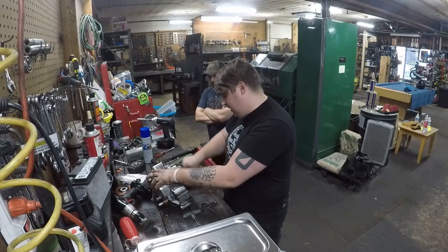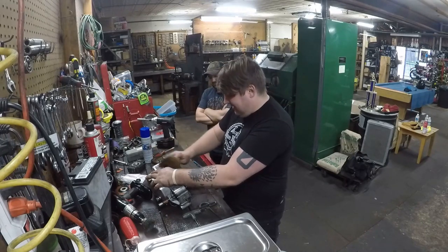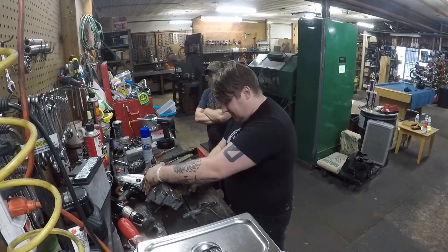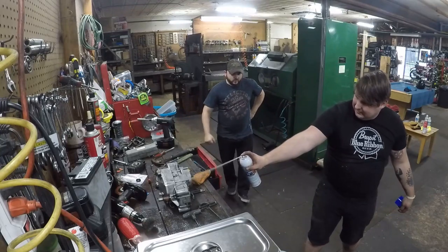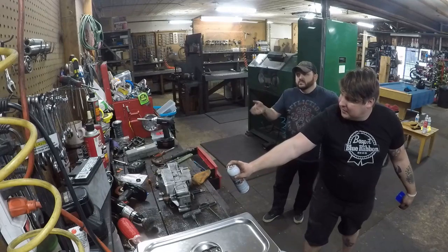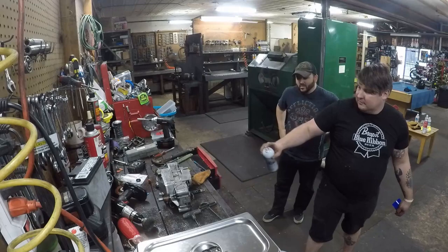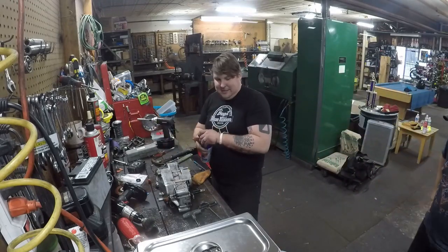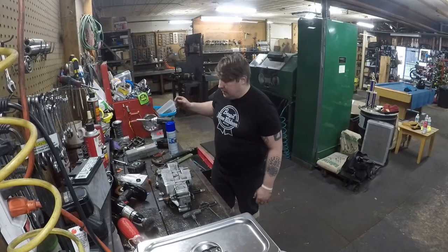And right now the springs I have in there, it revs to 10,000 RPM before it takes off. So I needed to engage a little sooner. The slippage is good. A little quicker. Stand back. Cool, I think I got you there. Sorry, buddy. No, you got me. All right, back again.